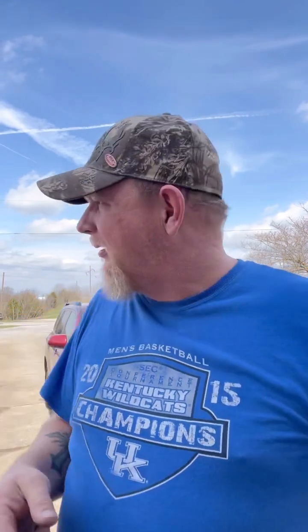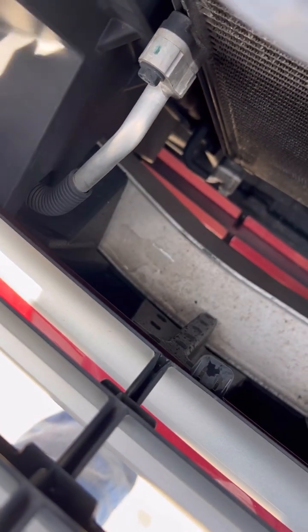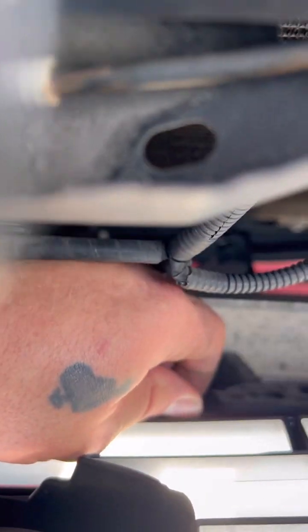On these grills, once you get the two 10-millimeter bolts off the top, in the bottom where it pops into the bumper cover there are several slide-in clips that have a leg that clips and holds into the bumper cover. See these little tabs right here? They've got a little leg on the bottom. You lift up on it and kind of rock it and it'll pop out. Lift up, rock it, pops out. One grill for a Toyota.